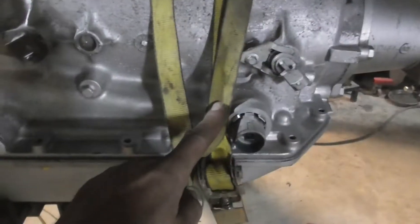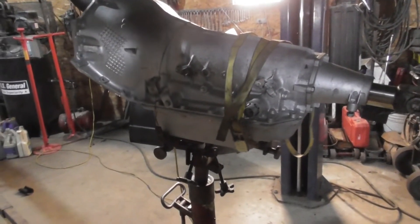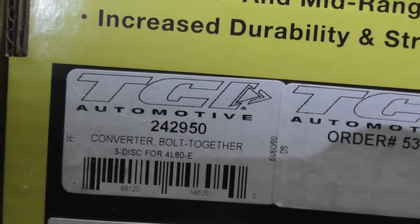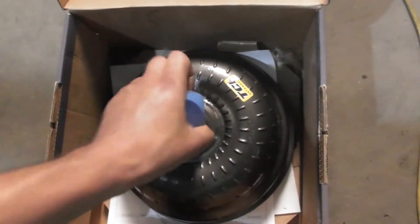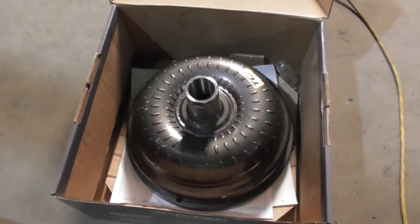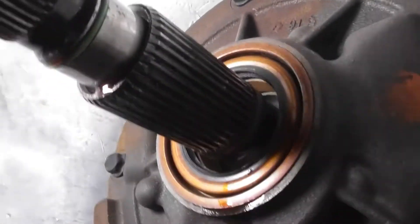I also wired it on and strapped it on so it's on there nice and sturdy. I'm doing this by myself so I want it strapped on there. Here's the torque converter I'm using — it's a TCI. The number is T42950 bolt-together, three-disc, multi-clutch lock-up converter for 4L80. I had them custom-stall it, same as the Super Street Fighter, which is about 3,500. So I'll dump a quart of oil in this, and once I get that done I'll lift it up and stick it in the transmission. You can see I've got that O-ring on in there, and we'll be ready to install it.